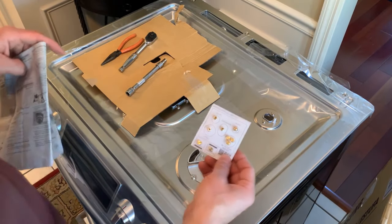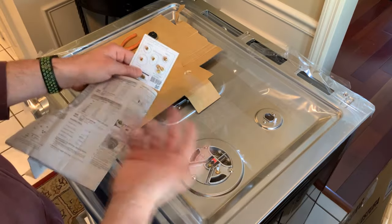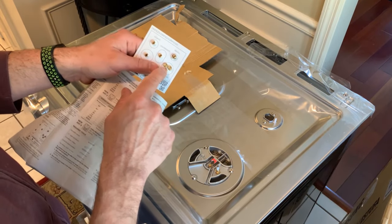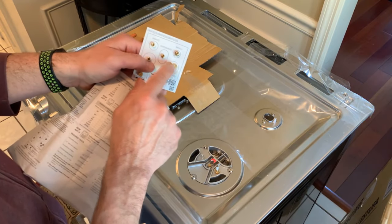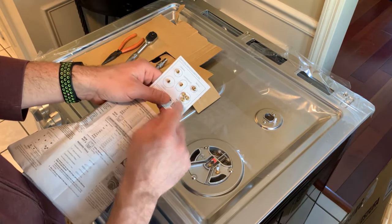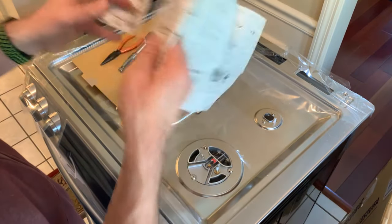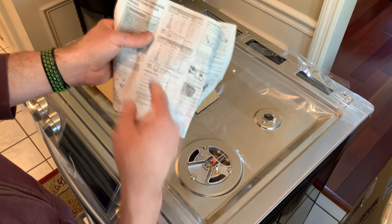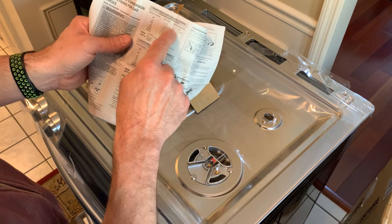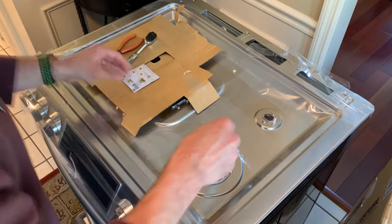Let's proceed with the right front. As mentioned earlier, the right front actually has three orifices — three burners in there. You really can't tell which is which just by looking casually. However, each one does have a marking on it: two of them say 0.74 and the last one says 0.46. I could guess that the two matching 0.74s go in the back and the 0.46 oddball goes in the center. The installation conversion kit manual confirms: right front contains two pieces of 0.74 and one 0.46. So the 0.74s go in the back, the 0.46 goes up front. Let's do one at a time — the center one first.